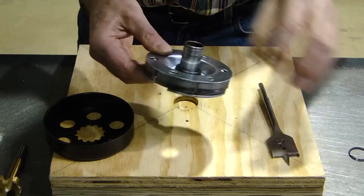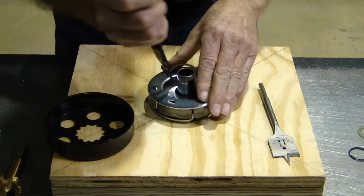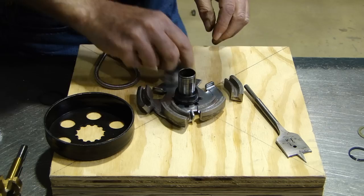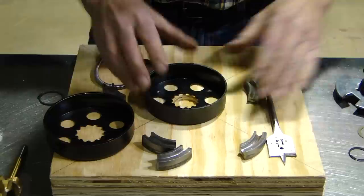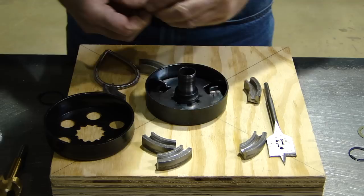Putting the clutch in the hole we've drilled and taking the snap ring off, you'll see why the clutch drum is used to keep everything together. One of the shoes did jump off, which will happen to you — that's why we want to contain everything in the drive plate using the drum. I'm only going to put one screw in here for speed, centering it and putting the screw in the pre-drilled hole.